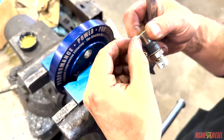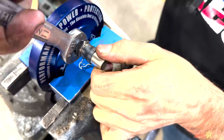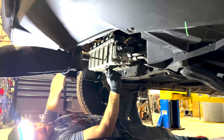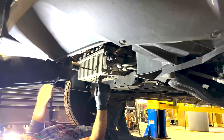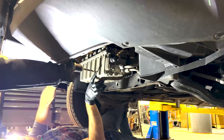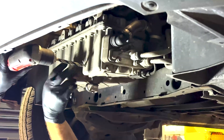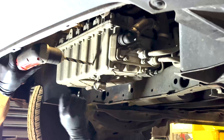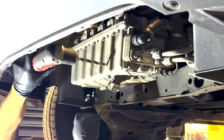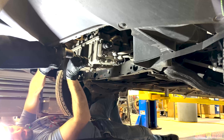This is our optional sample port valve — it's got a little dust cover. What we do is drill and tap the lid to your bypass filter, which is pre-bypass filter oil, all right on the top of your lid with thread sealant. Push the valve down and it allows oil out right here, so you'll have your engine running, open the valve, and flow it into the sample port. We have an adapter that goes through the drain plug, but it's a long sweeping 90 to the hose and hangs down a bit far. So the customer wants to drill and tap the oil pan — aluminum oil pan — and that's what we're doing here. We're going to drill into it and tap it to an eighth-inch pipe thread, then stick our 90 on it. The return from the filter will come into this new tapped port on the oil pan.